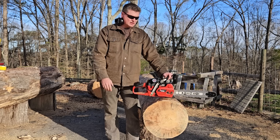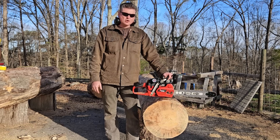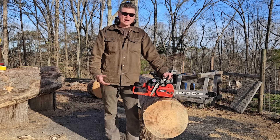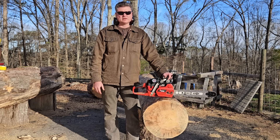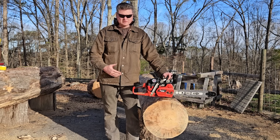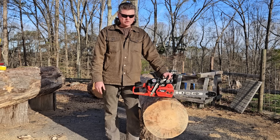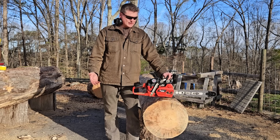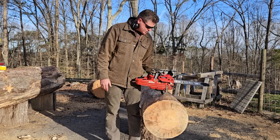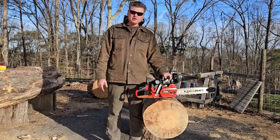The next step is either to fix this gauge, which I probably won't be able to do, or get a higher quality boost gauge and put a screen over it so that if chips are actually being shoved in there causing it to work erratically, we can avoid that. But yeah — it seems like it's actually producing boost, which is ridiculously awesome.